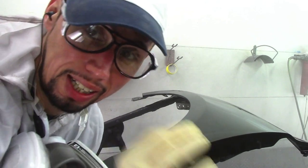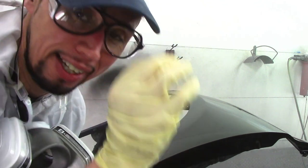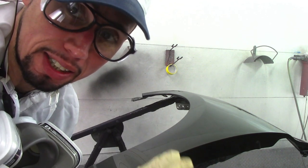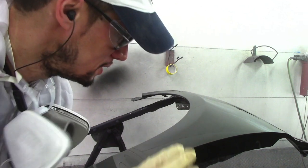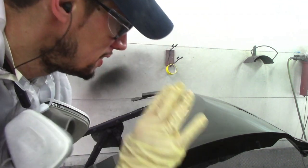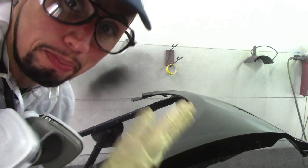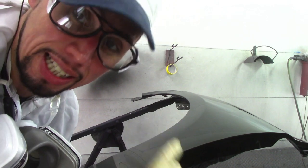Now just to give it a little bit more pop and shine and glaze to that shiny clear, I always put a second coat of clear right on top, and right after my second coat I put a third coat of clear, one on top of the other after the second coat, just to give it an extra nice pop of clear shine. It looks really nice and flat. The reason I'm able to do this is because this fender is laying down flat — if it was upright when I tried that, it would probably run, but like this it can be done.